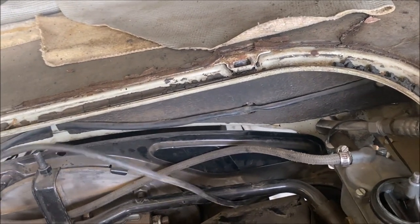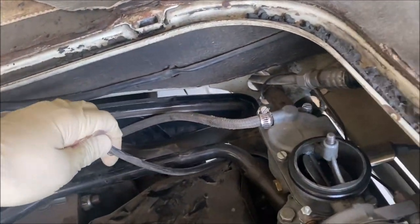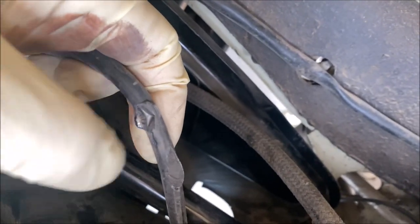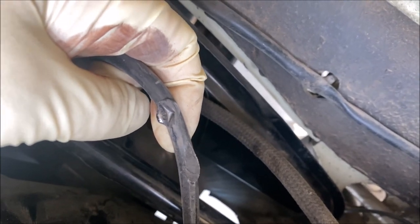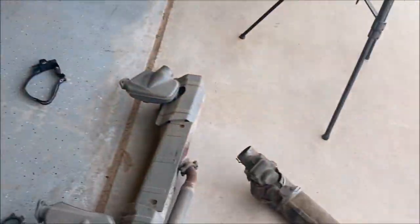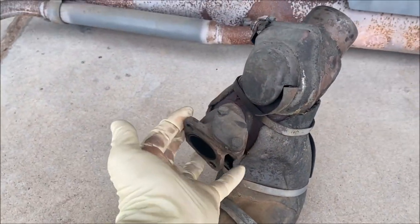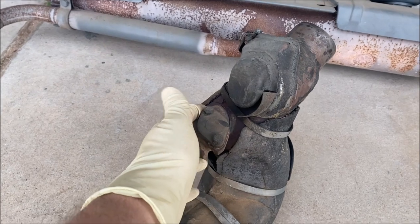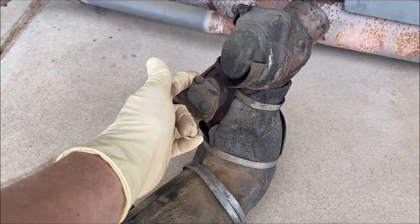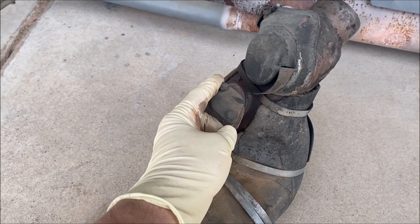While we were doing everything, I found one of my spark plug wires had actually been laying on the exhaust. I don't know if it made it all the way through, but that's definitely a weak spot where spark could jump pretty easily, causing the car to run as bad as it has. On the passenger side heater box, this is what came through the engine tin - the driver's side doesn't have the same mount. That spark plug wire was laying on top and had melted right to the bolt.